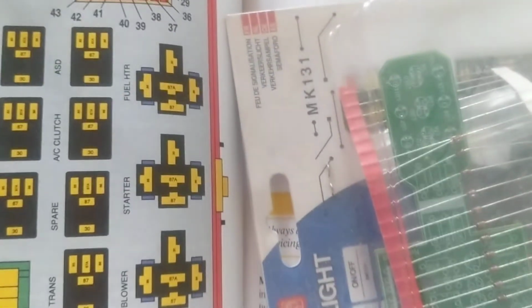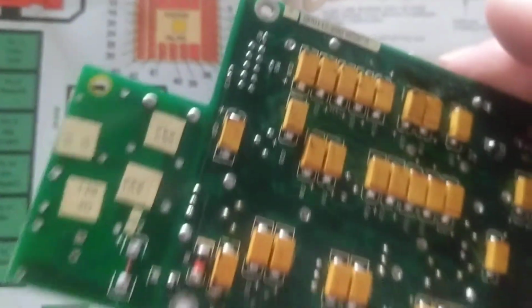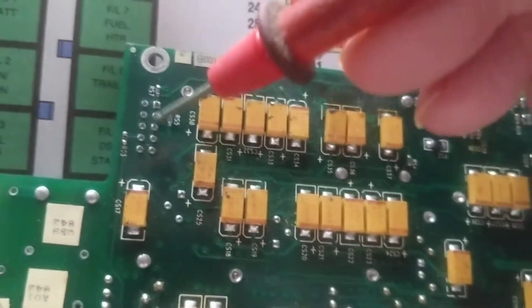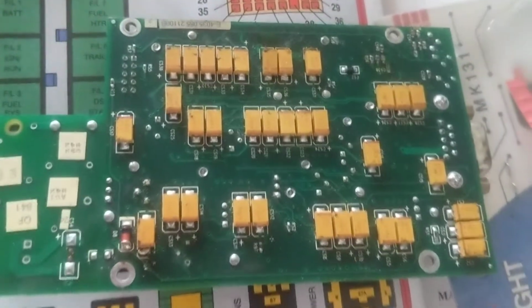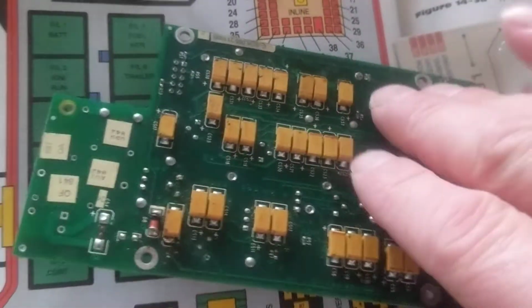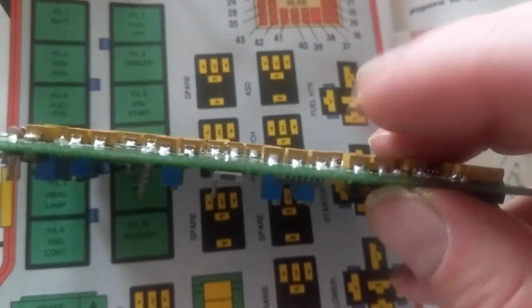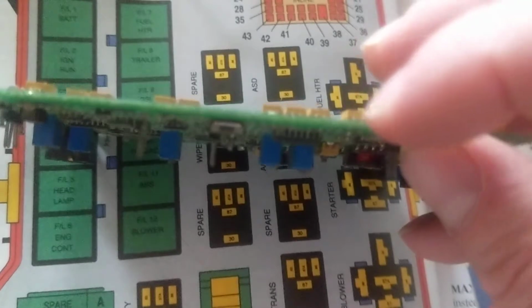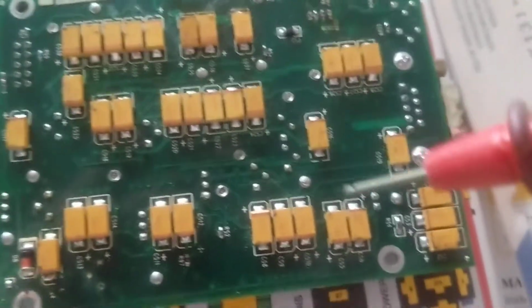So anyway, you'll see it, you'll understand it much better. But before I do something, I like to explain it first. About printed circuit boards that I was talking about before, this is through hole, this is surface mount, obviously. PCMs or PCM boards, like I used to repair, are double-sided. I spoke about it before, but I didn't give an illustration. Double-sided means there are components on one side and components on the other side. In between the top and the bottom layer are other layers, like a sandwich. Those are used sometimes for B+, sometimes for grounds in between. So now at least you understand what I'm referring to.